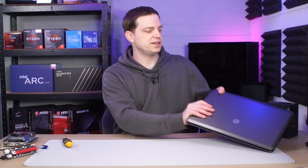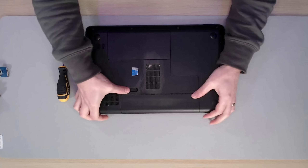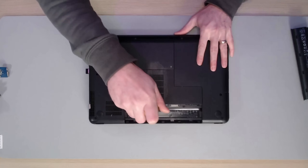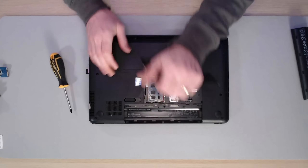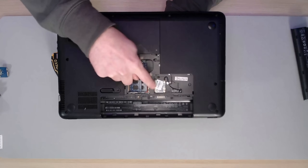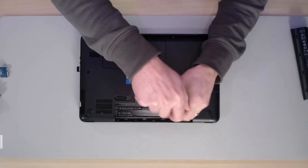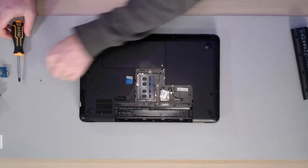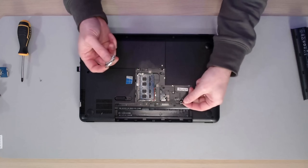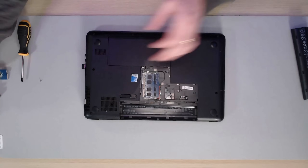To get all this hooked up, we need to take apart the laptop — we'll need a screwdriver. Some laptops you can do without screws, but first we remove the battery, then take this panel off by removing the screw. Inside we can see the mini PCI Express slot — it's taken up by the Wi-Fi card, so we remove that by taking out the little screw, popping the card up, sliding it out, and disconnecting the Wi-Fi wire. We'll tuck that in so it stays out of the way, and then install the riser card.